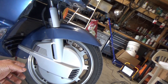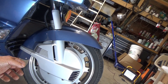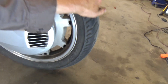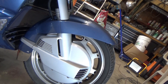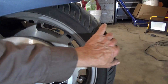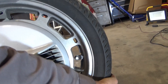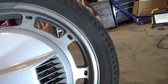I had to do a little bit of work on the caliper recently to try to free it up — it was sticking, locked up real tight. Got it freed up some, it's workable now, but it's about 36 years old, so it won't last. I'm going to go ahead and put kits in them and also change the front tire. I found a spot I was concerned about on this side, so I bought a new tire.